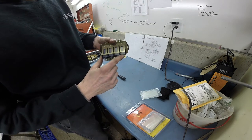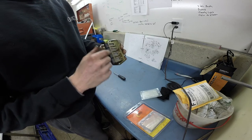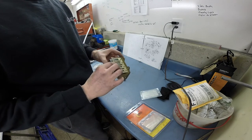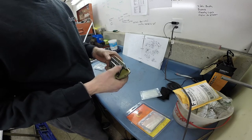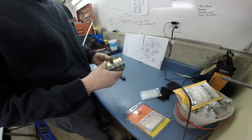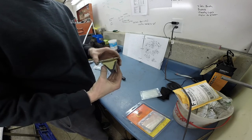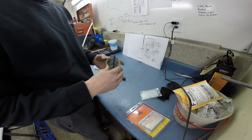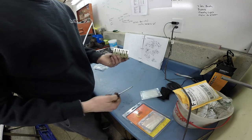The ends of the reeds are starting to chip off a little bit. It looks like I'm getting a decent enough seal on them, but I got new reeds so I don't want to lose any power because the ends are starting to chip back. I've had a goofy thing with this sled where it kind of only likes wide open, but it could be attributed to some other issues. Since I had the throttle bodies out, I'm going to do my reeds and make sure that's not an issue.